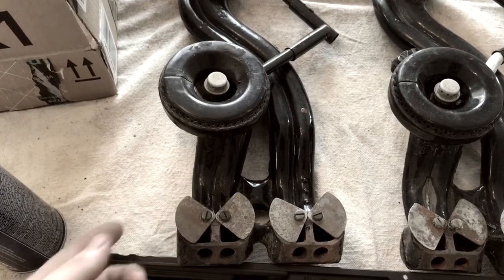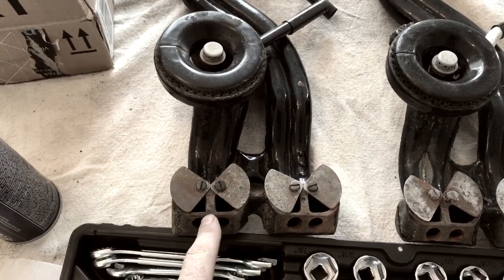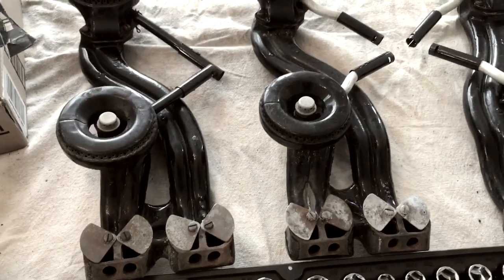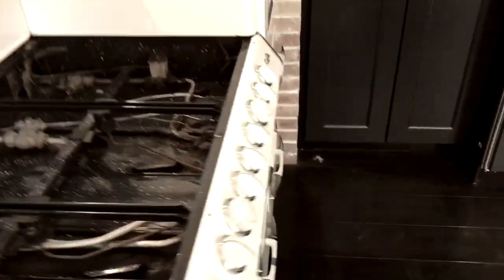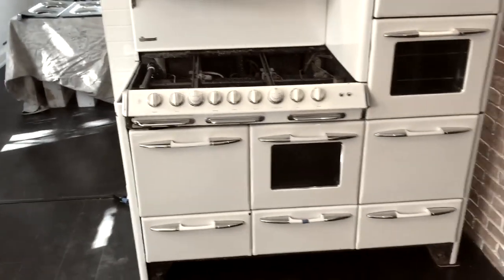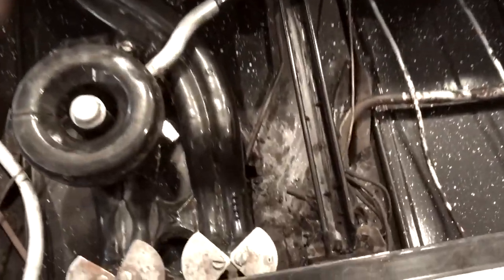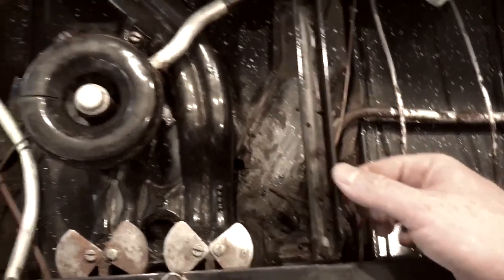If you're noticing issues with the color of your burn — again, you want a nice blue flame — you can adjust these, I'd call them butterflies, much like an old-school carburetor. You can adjust the air mixture by opening and closing these. I didn't have to mess with any of them and you probably shouldn't either — chances are they're already well-adjusted. But that's their purpose: air mixture. Don't be afraid to tackle this project; it just takes a lot of elbow grease. This is how you remove the burners — I've gone ahead and taken out the screw right here so that this can lift up and down.